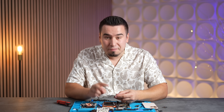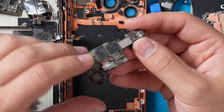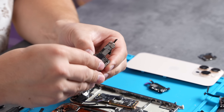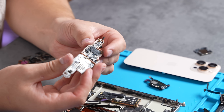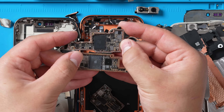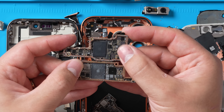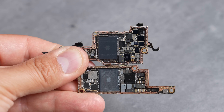We actually have two Qualcomm chips — the X80M modem, which is great news, and then also the SDR875, so the RF side might be a lower grade compared to what Samsung gets for their own devices. Now looking at the A19 Pro chip — after cutting open the logic board, look at all that thermal paste. The A19 Pro is on the inside of the sandwich, and interestingly it is actually smaller than before, using TSMC's third-generation 3-nanometer process. It has the same six-core GPU and CPU layout but adds extra cache and neural accelerators for each GPU core.